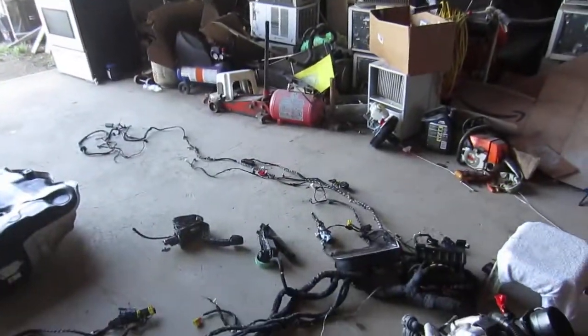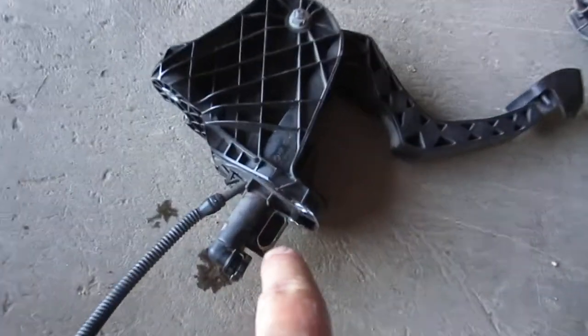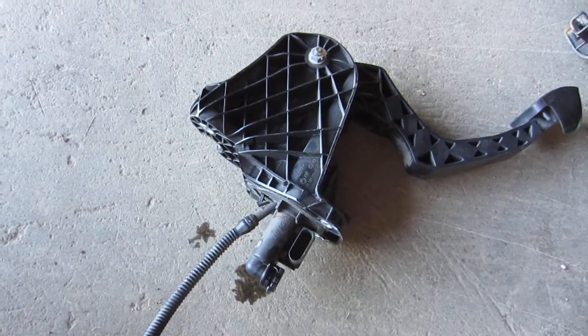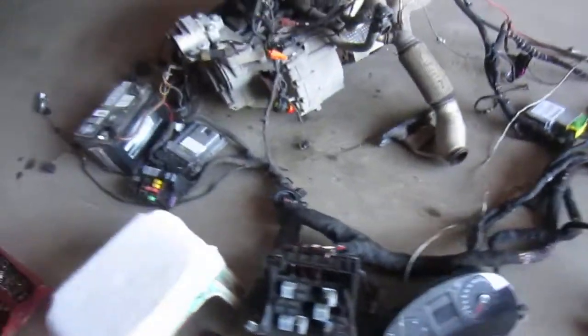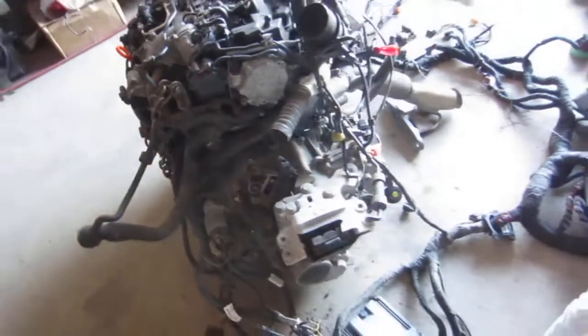There's only one thing — I can't start it with a key, although I can turn it on with the key. The problem is this has got a hydraulic switch in the clutch mechanism, and I don't know which two of the four pins to bypass without frying something to make it start. So I can turn the key on and use my little jumper wire and see if that's going to work.